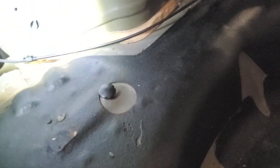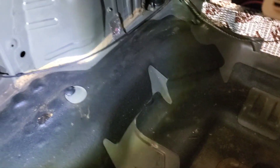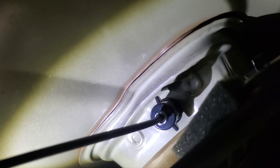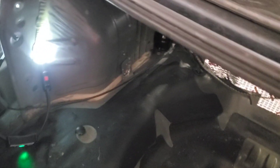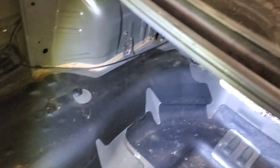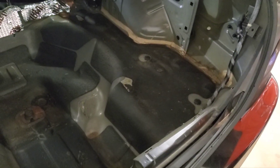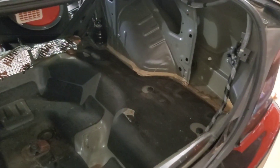I've already been in here before to change out the fuel door and trunk cable because mine failed. If you ever have an issue with it failing, see that little barrel right there - you twist it out and that door will pop open. I'll do a video on that because I was stressing at the gas station. When that failed and I couldn't get gas and I was almost out - I didn't know how to get to work or how to call them and say I can't put more gas in the car because fuel door.